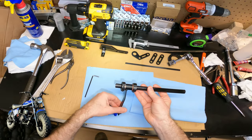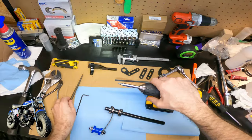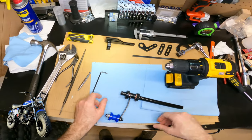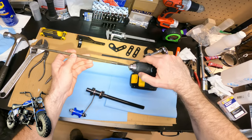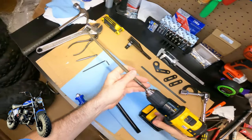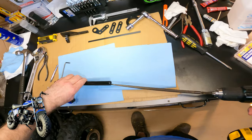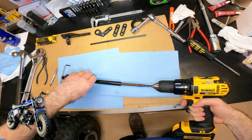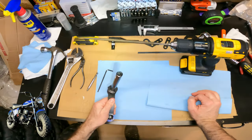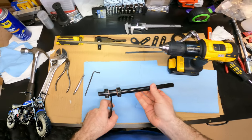The painted tube actually fit a little better too. The locking collars were a little too tight and messing up the threads — it wasn't working right. I tried a 3/8-inch drill bit but that didn't work since the hole is already 3/8-inch, and I didn't have the right metric drill bit. What ended up working amazingly well was a rat-tail file. First try, I got it in there perfectly — just spun it around inside the hole, kept test-fitting until it was just right. You don't want it too loose either, so just file it out and keep test fitting.